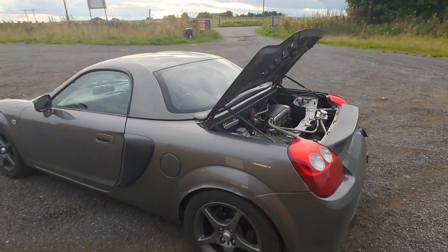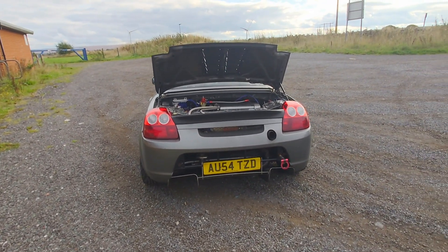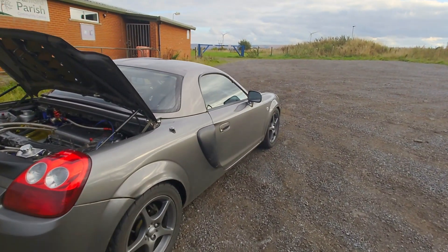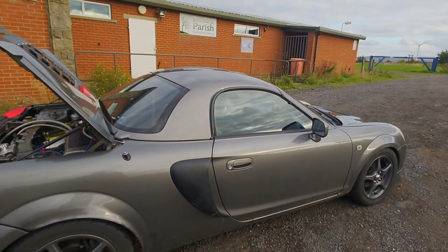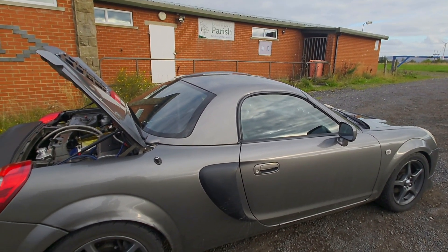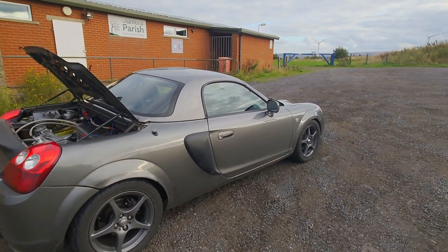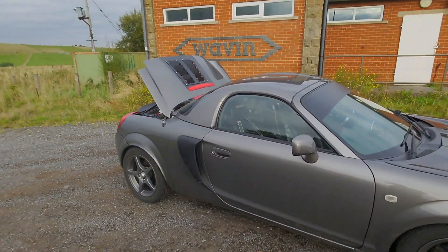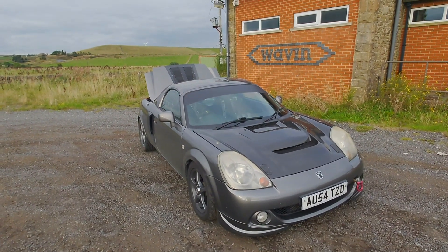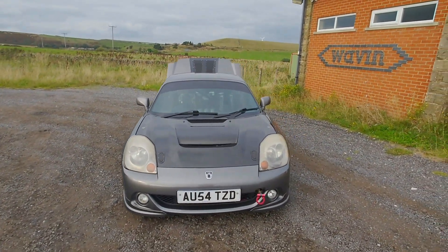The rest of the day is just tweaking the fuel map to get the AFRs right where I want them for general cruising. I've got them set at 11.5 at the moment on full pulls. It does richen out to around 11.1–10.8 once we get into the 7,000 RPM range and onwards. Boost is currently set on the wastegate spring at 12 PSI, tailing off to 10 PSI from about 6,000 RPM onwards. I don't want to up the boost until I've got it on the dyno to see what power it's making, as until then I won't know how close I am to the engine limits.